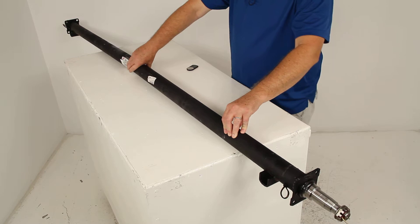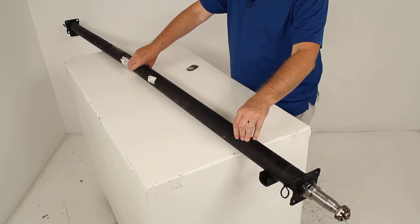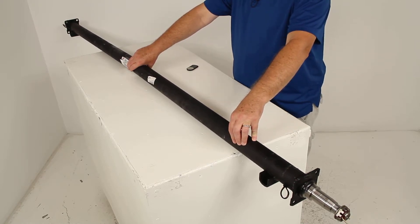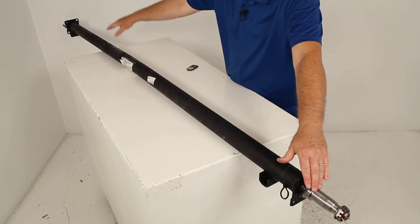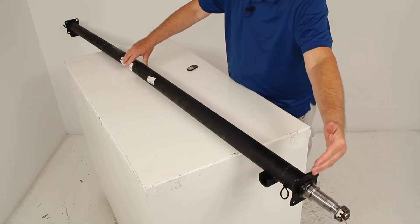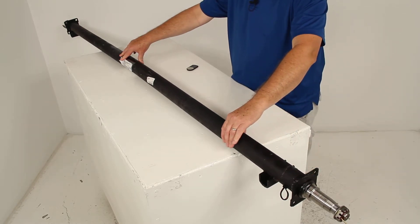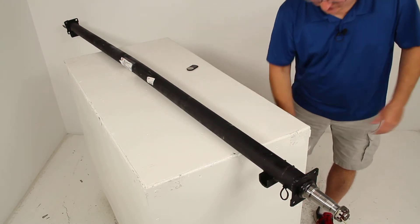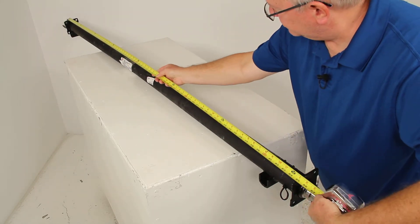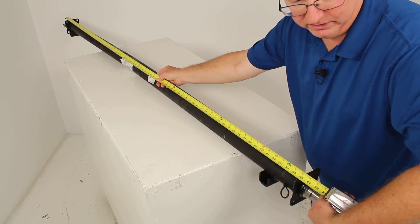There are multiple ways to measure the length of an axle beam, but basically the two most accurate ways are going to be hub face to hub face and spring center to spring center. The hub face to hub face measurement is when you have your hubs mounted on each end — you'll measure from the base of one wheel stud on one hub, go all the way to the other side, and measure to the base of the wheel stud on that opposite side of the axle. This axle doesn't have any hubs mounted on it, but just to give you an idea, I'm going to run this ruler where it's roughly going to be — about 89 inches is where your hubs would run hub face to hub face.